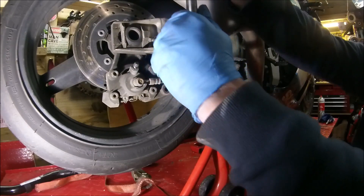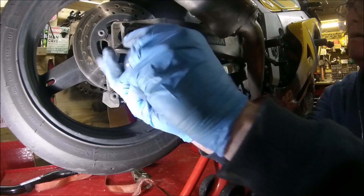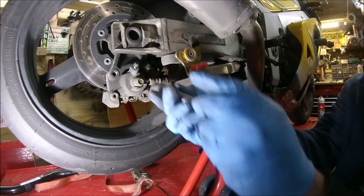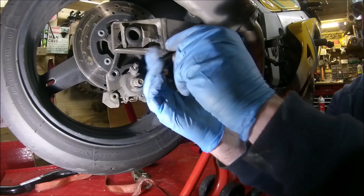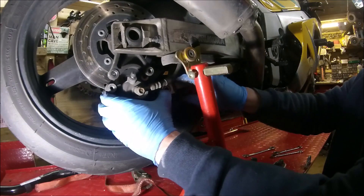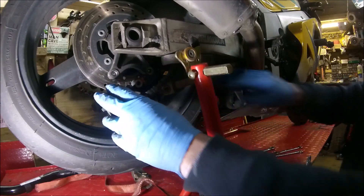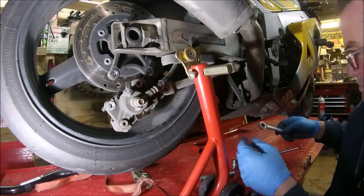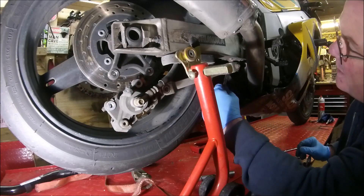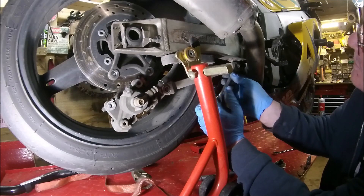There's one, two bolts. As I said in the last video, I've travelled through the space-time continuum. I think I need to undo this end of the torsion bar as well. I've got 14mm on the back end and 12mm on the front end.